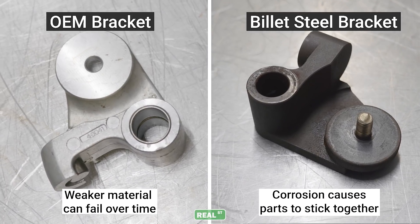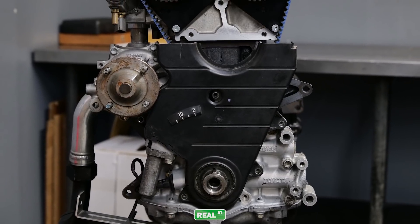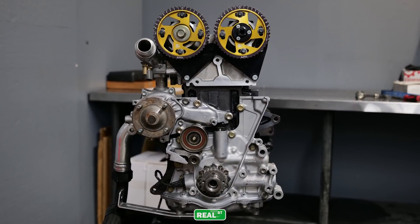The belt would lose track, rip the teeth off the belt, and the engine is now out of time. One of the reasons why we went with this bushing design is that steel cannot mate with the bronze bushing — it is an OEM quality approach. The reason the OEM had a bushing in there was to keep the dissimilar materials from ever mating.